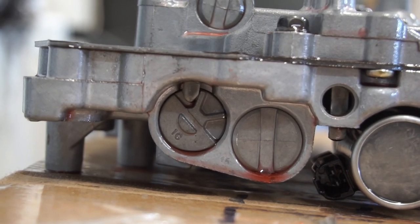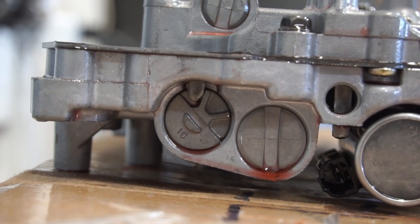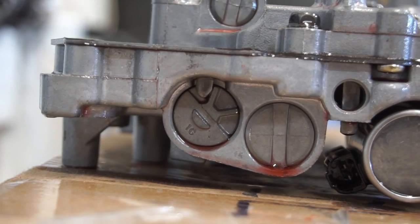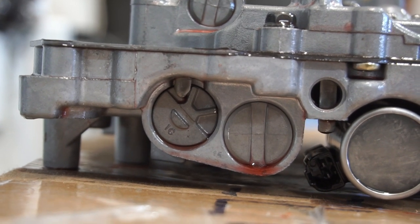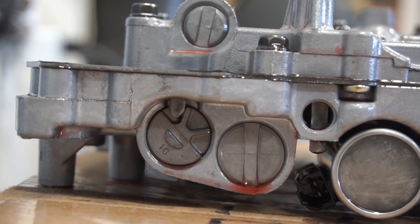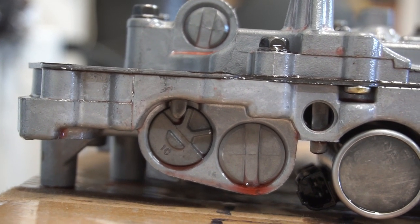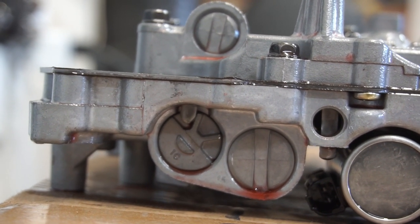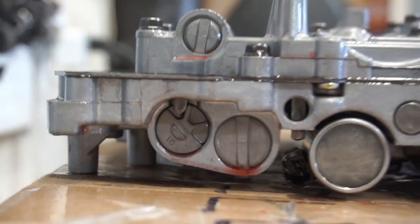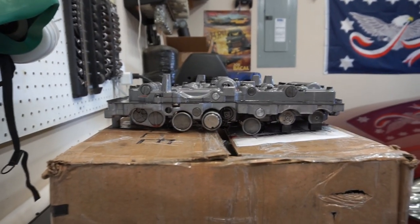Let's take a closer look at that. When you push that in and turn it clockwise, it'll go to that third position. That will increase your line pressure across the board, and it will decrease the heat and wear on your transmission. So if you read anything that says it caused transmission failure for someone, their transmission was going to fail anyway. This, if anything, will actually increase the life of your transmission. I ran it for about 25 to 30,000 miles before I did my valve body modification, and I had zero issues. I recommend turning that dial and getting the Duralast Strainer Kit.